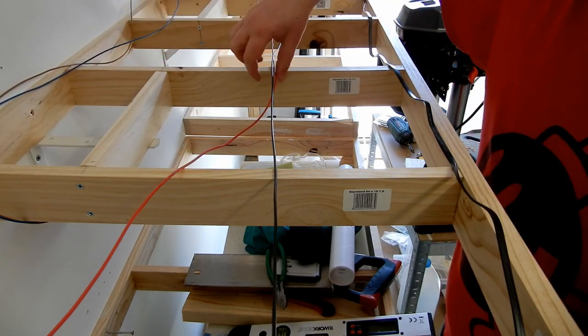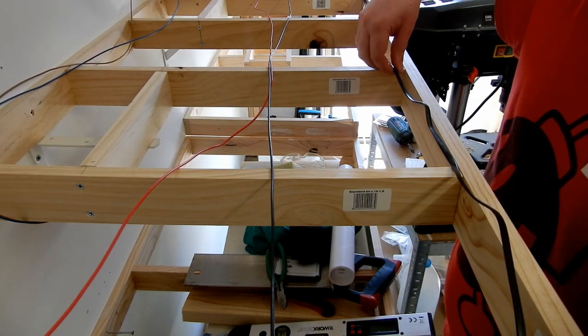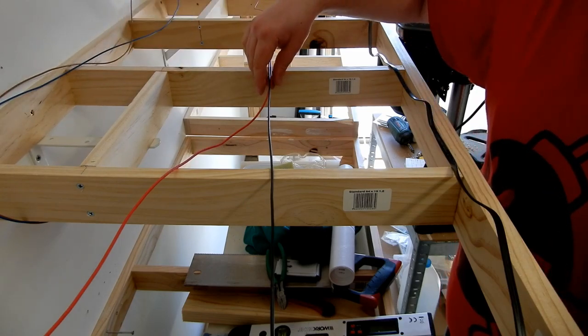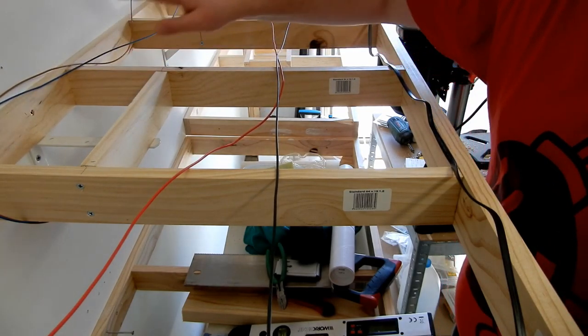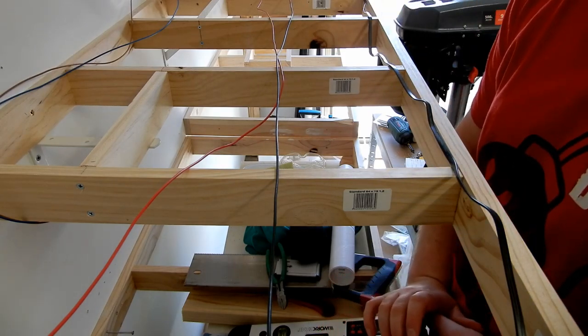So the idea is we've got good sizable gaps in between the wiring. Interference from this wire is not going to cross over to here and vice versa. Same with the accessories to here. But the other thing is also these are going to be twisted. Same with these, just to reduce and try and prevent any interference, particularly across this layout.